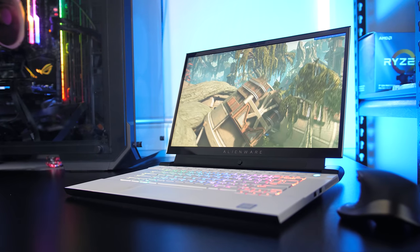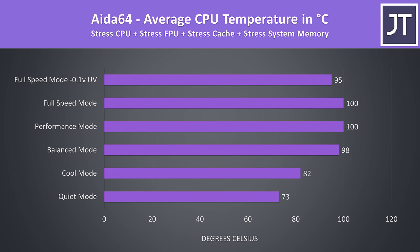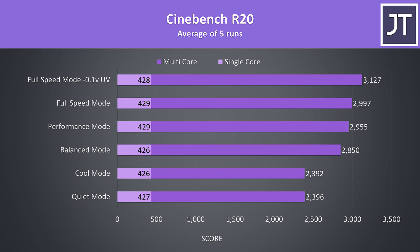Now let's look at a CPU-only workload with the GPU idle. Here are the clock speeds while running the Aida64 CPU stress test with all default options checked — we could only hit the 4GHz all-core turbo speed with the undervolt in place. Thermal throttling was taking place in balanced mode and above, however the undervolt reduced temperatures a little since less power was needed to hit full speed. Cinebench results were very nice when undervolted — essentially a best-case 9750H multicore score — because the 4GHz all-core turbo was constantly being hit. It was running in the mid-90°C range due to the higher power limits possible in CPU-only workloads.